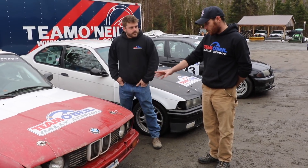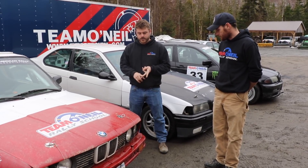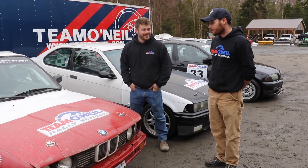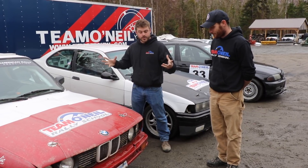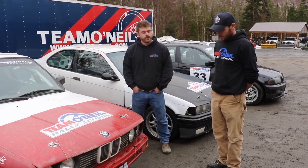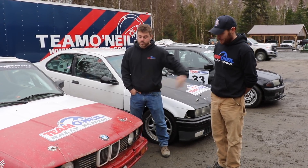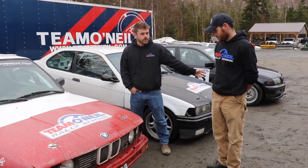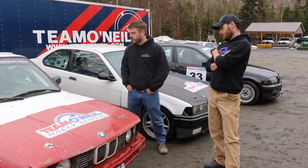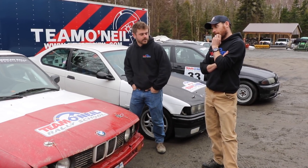The IS is always two-door; the I can be two-door or four-door. The ES has a larger but lower compression 2.7 liter motor — they actually make less horsepower with a bigger motor; they were more for economical cruising. The older 318s have a very underpowered four-cylinder, while the newer 318s in the 1990–91 range have a nice twin cam four-cylinder that makes around 140 horsepower. So it's lighter versus a bigger six-cylinder — it's up to you.